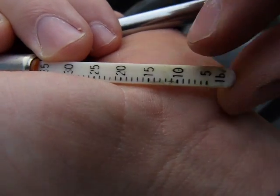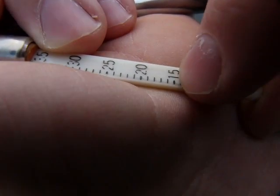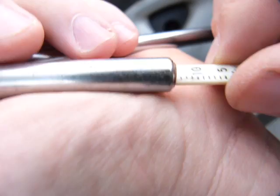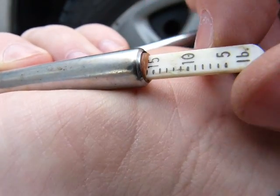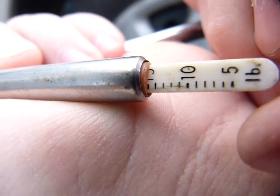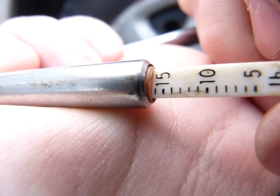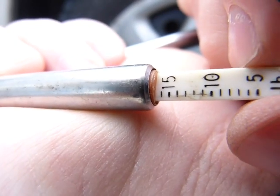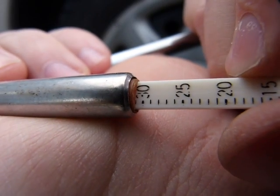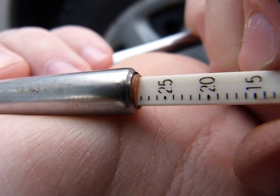You can see it is 5, 10, 15 and between those numbers there are little hairlines without numerical digits — so that would be 11, 12, 13, 14 PSI — and you take a reading at the base of the tire gauge. So this one reads 15 PSI as is. This one reads 16 PSI, this one is 16 and a half, that's 17 PSI. Normal tire pressure is somewhere around 30, 31, 32, maybe 35, maybe as low as 28 depending on what you do.